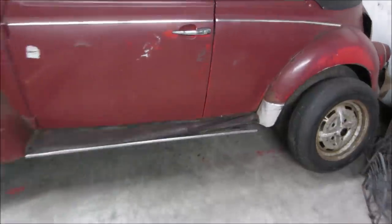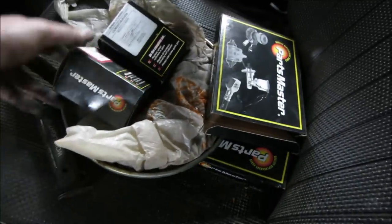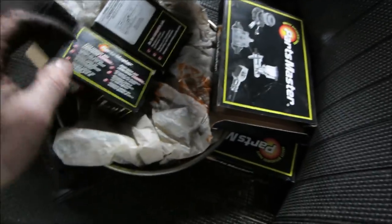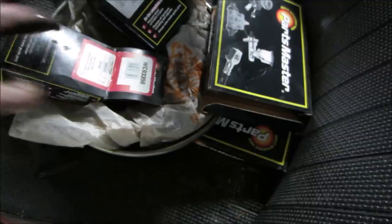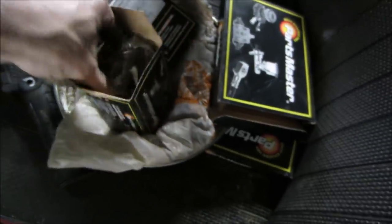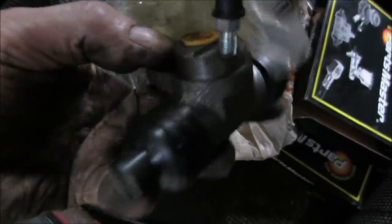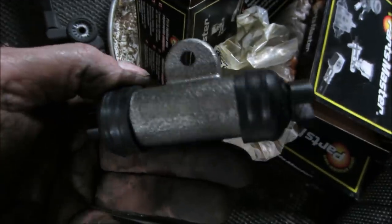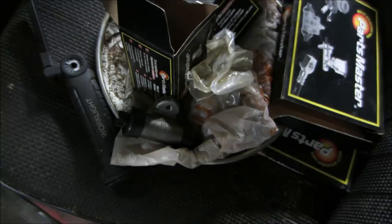Let's go shopping. This car, I believe I had gotten some wheel cylinder or something for it at one time. They were the wrong size. This is a 68. Let's go see the, I think those are flex lines also. And yeah, we just have to order other ones, but it's nice to try to be able to use up what you got, right? They look a little small, don't they? We'll bring one of those over. Actually, they might be the rear. Your front brakes do most of your brake work, so they're usually larger.